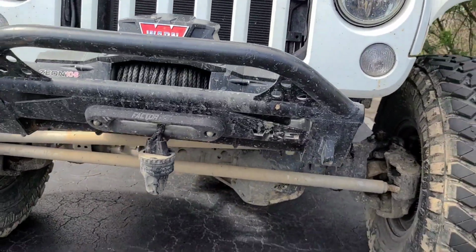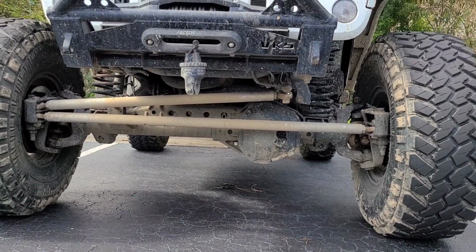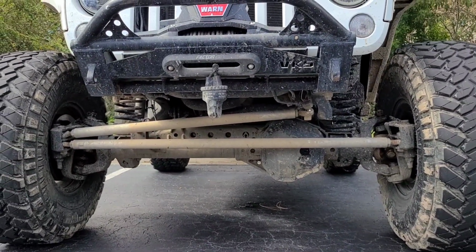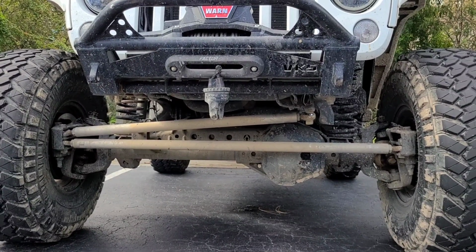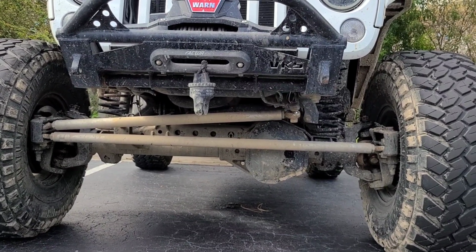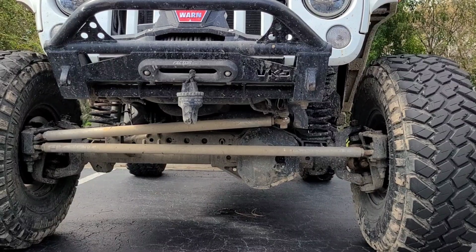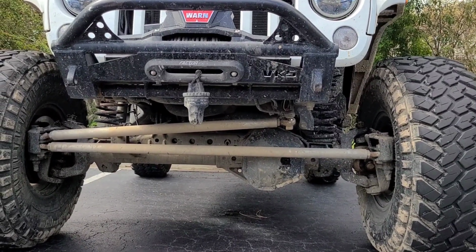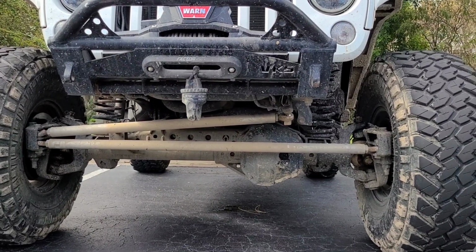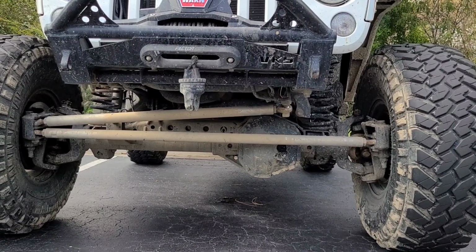For the Jeep JKs, there are really three main choices of axle you can run: the older Kingpin Dana 60s, the 99 to 04 Super Duty 60s, and the 05 Plus Super Duty 60s. The advantage of the Kingpin is it's not a ball joint axle, so you're not going to have to worry about destroying a ball joint, but now we have lots of options with ball joint eliminators and such. I personally don't see that much appeal for a Kingpin axle anymore, but to each their own.